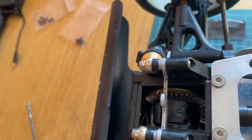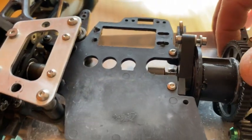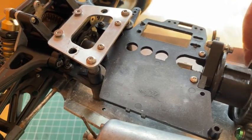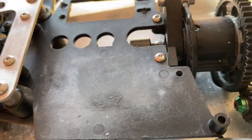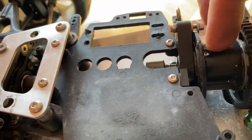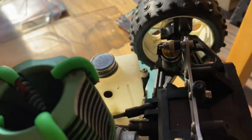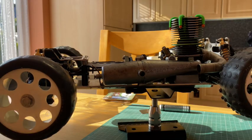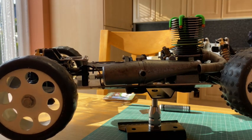We'll get some grease in, do the back one, and the center diff - there's a little notch at the top where the grub screw goes. That's all done - grub screw in the back, center diff done, and the front diff done. That should keep the thick diff oil in the planet area of the diffs. They were bone dry when I took them apart.